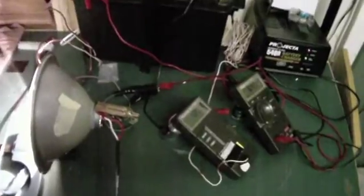Hey everybody, this is another educational video from HID Lights Down Under. What we're going to do today is a little experiment to show everyone the temperature difference between halogen versus HID with various kits. What we have here is a Hella 4000, currently running a 100-watt Osram bulb that comes standard with the light. We have fitted a J-type thermocouple to the front of the light in the hot spot.